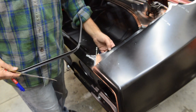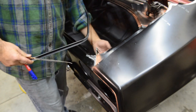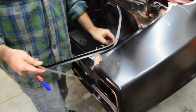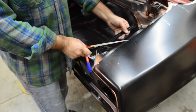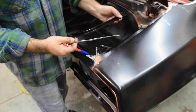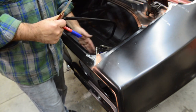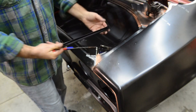So that's another problem with AMD stamping. And the other big thing is it's too wide. So I've got to trim this back to less than a half inch of width from the inside edge to the outside, probably around 490 thousandths, because this goes up underneath like that. And it has different recesses for where there's overlaps, like where there's a doubler back here for the weather strip channel, and the same up near where the deck filler panel is.